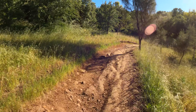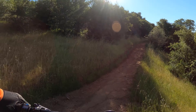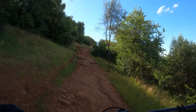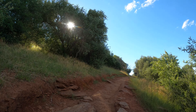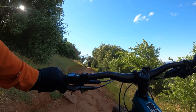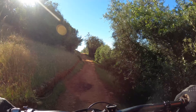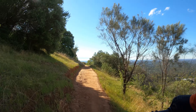So the reason I pulled the ZEB apart - it's either that spring has a very small negative air chamber, or it was greasy, which I wouldn't really expect from RockShox. I got to the stage of checking that spring and I should have pulled it out and had a look, but once I realized how much misalignment was there I didn't even bother pulling the spring out.